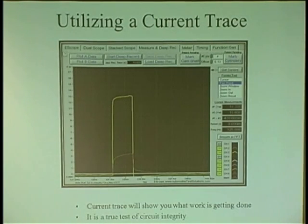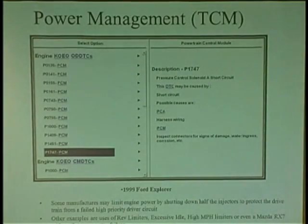That's a smart driver. Now here's a dumb driver going like this, like that IAC control motor or the motor mount driver. Grabs a holder, goes, oh my God, oh my God. Goes, let go, dude. No, they didn't tell me let go. They told me to hang on for the ride. Meanwhile, the new smart drivers do this. Oh, no problem, dude. I'm cured. I can hang on to you, but I'll just elevate myself. So those are smart drivers. Smart drivers can prevent the car from being damaged. And understand that you can't just look at volts. You look at the amps. You have to look at both. That's done with an amp clamp, by the way.